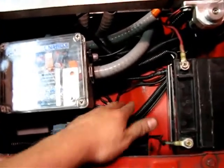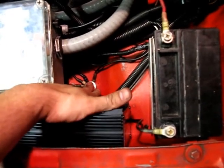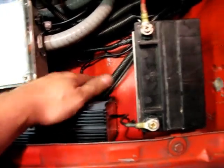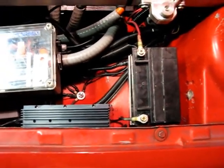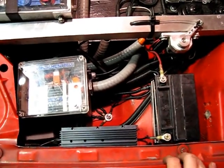You might also notice this big bunch of wires coming in here. This is the main ground for the car — grounded to the body of the car and the 12-volt system, connected right here to the negative of the battery. Pretty much all of the main systems come in to that point, so they touch both the car body as well as the negative of the battery.